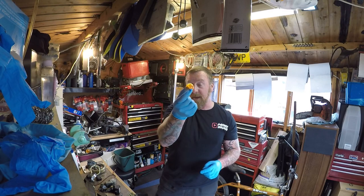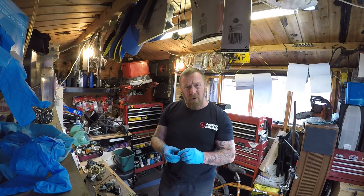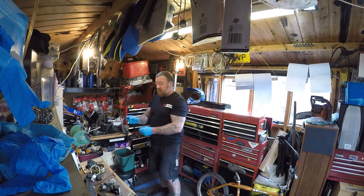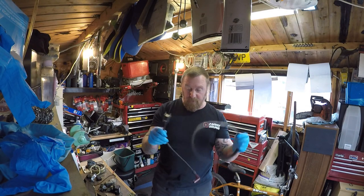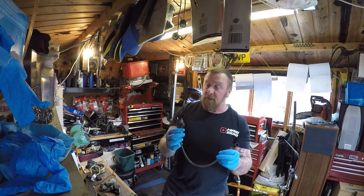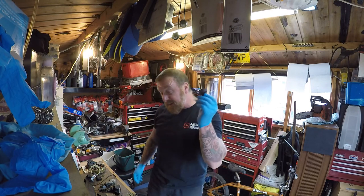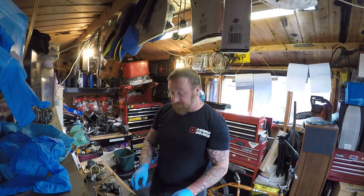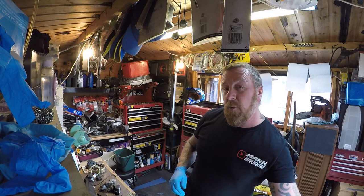I was right — on the other side the indicator was missing, so I've got one of them now. It's not going to be a white light, which is illegal by the way, and they were loose as well, not tightened up. I went through my other junk — when no one's got a spark you always think to check the HT coil with the plug. This one works. I've got lots of little parts, but I hadn't got one of these, so I had to buy one — managed to get one for seven quid.